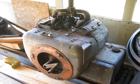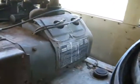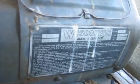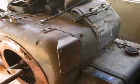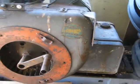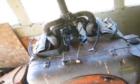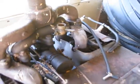So here we have the old ice cutting machine with the V4 Wisconsin on it. Turns out that this one here is a VE4 Wisconsin, the same as the other one I have. This one's serial number 1243716. 3-inch bore, 3 1/4 stroke, and it's all original color there, gray, and you can see it even says most horsepower hours, Wisconsin heavy-duty air-cooled engines. Got the hand crank and everything, and she still cranks over, not seized or anything. So that's good. It's got a little gas primer there to help you start it.